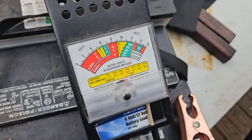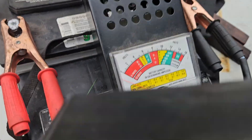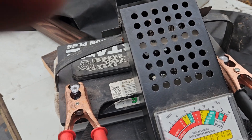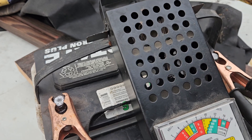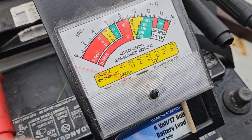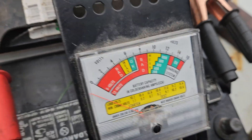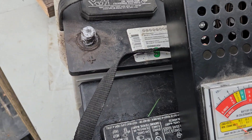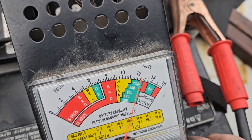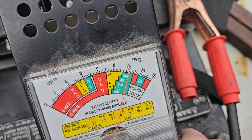Now the other battery — put my negative to the negative, positive to the positive — and I'm reading minus on this one. A week ago I put this battery on the charger, it was dead. I tested it two days ago and it was fully charged. I tested it this morning and now it's reverse polarity — we're still on zero. Hit my tester, it jumps. Switch the cables: positive, positive, negative, negative — we're right up there. Hit the load switch, it comes down, moves a tweak, let go and it goes back up.